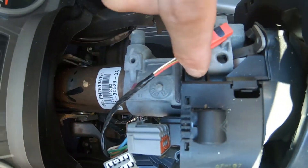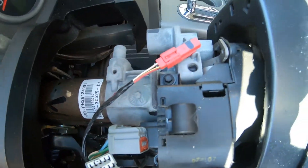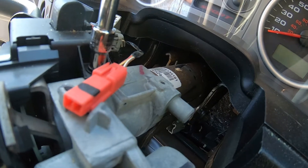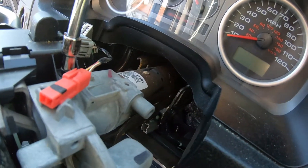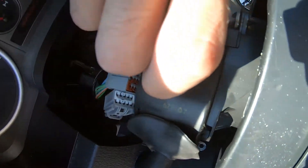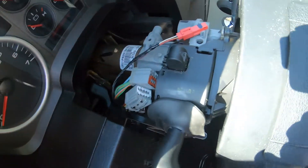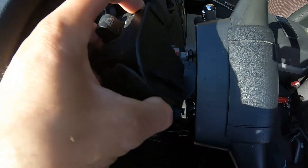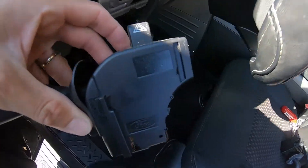Now on top there's another 5.5mm bolt to take off. Take off the 5mm bolt to the turn signal switch, tab right here — push on that and lift the turn signal switch out. Just lift it out — pretty simple.